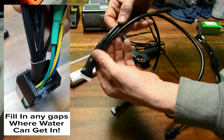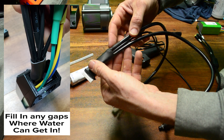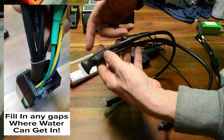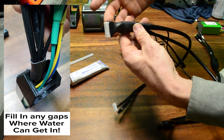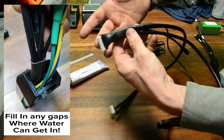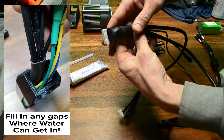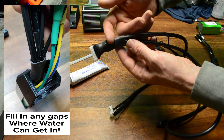When you have so many wires exiting a harness it's difficult to make a waterproof seal with shrink wrap. If water gets on the wires and runs along them, eventually moisture is going to get down into the connector part at the end. It will lead to corrosion of the pins, intermittent problems, and eventual failure — I've seen lots of photos of green-looking harness pins. If you're starting to get discolouration on the pins, it's very likely moisture that is causing this.